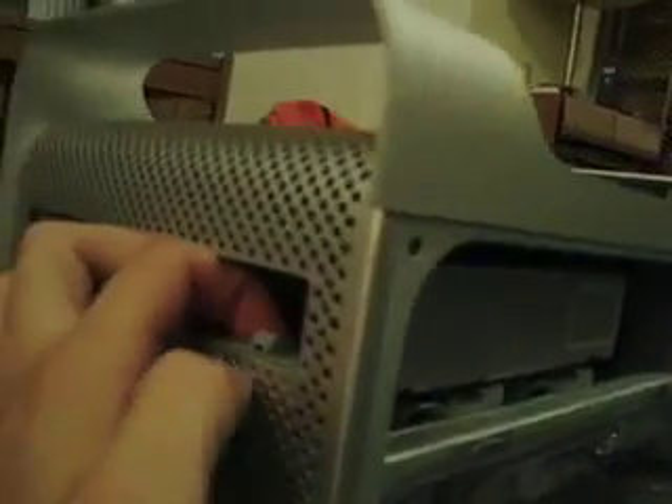The hard drive will spin up and the fans on the power supply spin, but that's it. None of the other fans in the computer work, there's no startup chime, and the optical drive does not seem to receive any power — if I push the button to open the drive, nothing happens.